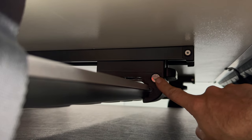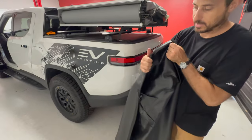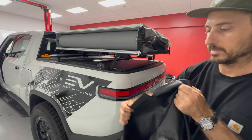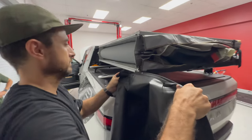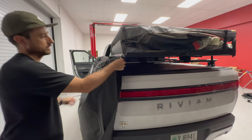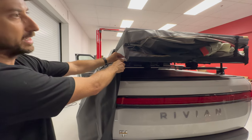We can now go ahead and lock the lock so we're nice and safe. We're ready to put the cover on. Find the side of the cover that has the bead channel on it — it corresponds to the track on the hinge side of the tent. Take that bead and run it along the channel, which locks in that side. Then fit the cover over the top of the tent. It will go on without doing this first, but it's recommended to lock it into the track first.